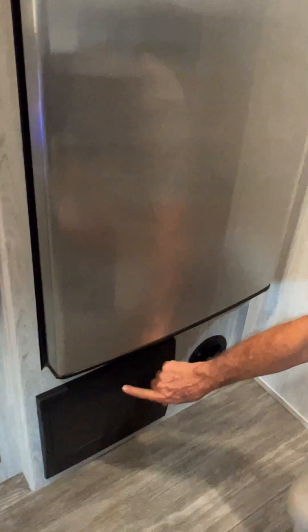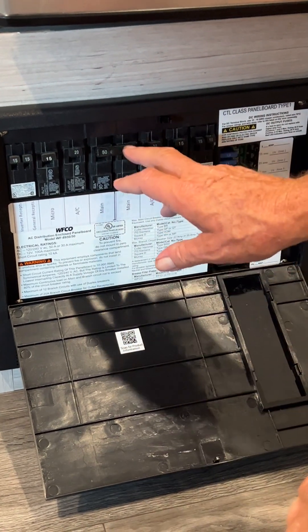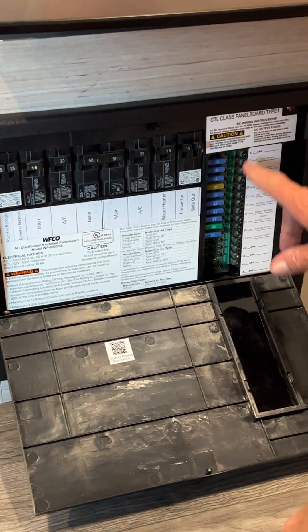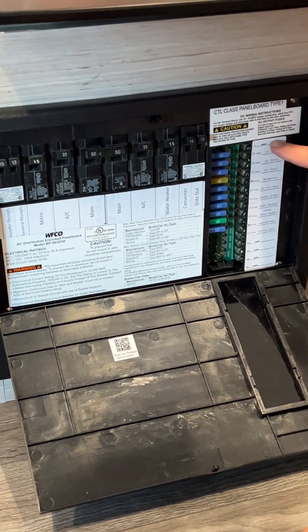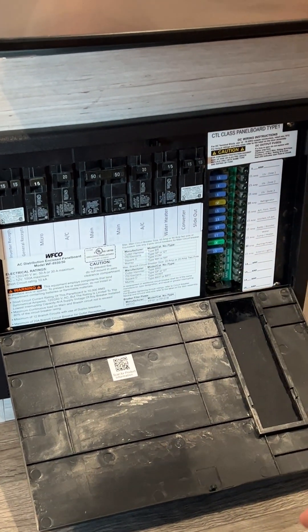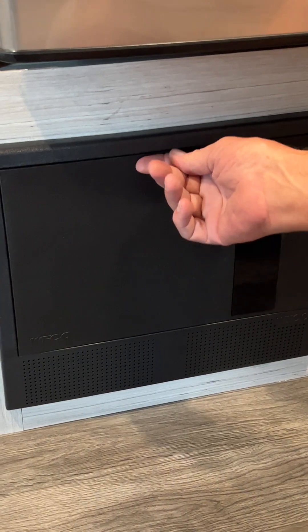Right down below the refrigerator is the breaker box. It is marked from the left-hand side to the right exactly what they are, with your 50-amp main being in the center. Your car fuses on the right-hand side from top to bottom are marked exactly what they are, and they give you four spots at the bottom that are empty and one up at the top. They also have a red light on the right-hand side of the fuses to indicate anytime a fuse is blown — that little red light beside it will come on and you can also see it through the tinted window in the front.